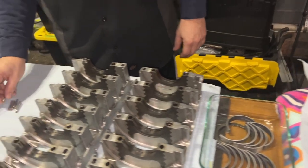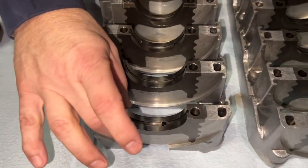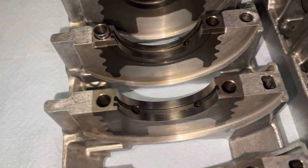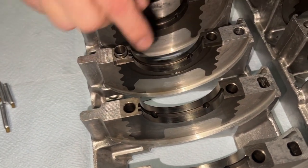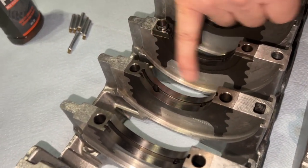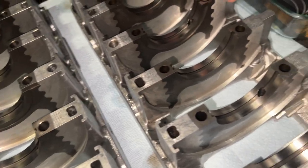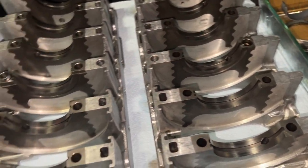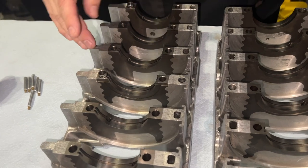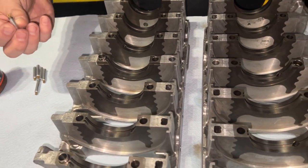Another important part of this are these squirters. You will see that these bearing holders, the place where the bearings go, have different holes. They will go through the bearing, of course, and lubricate when needed. But in six places, three on one half, three on the other, there are slightly larger holes. It's a little bit difficult to tell from this dimension, but it's on the outside. On this orientation, it's on the outside. So when this is assembled, every one of these crankcase holders will have a squirter attached to it. Very, very important to put him in.